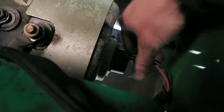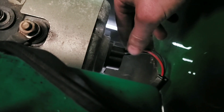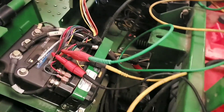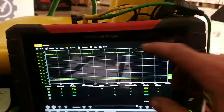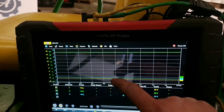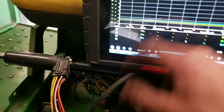The speed sensor is right back here. We can go back there, we will — we'll double check that. But this is more universal, showing general principles and why we don't need to be scared of a bunch of batteries, some electric motors, and a motor controller. We can see we have our 14-15 volt supply and then our green trace here is going to be our signal wire.